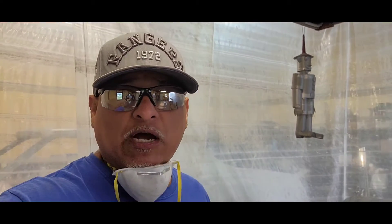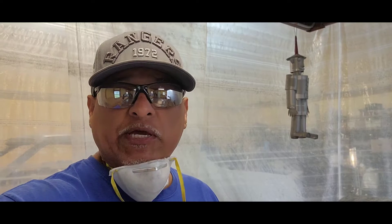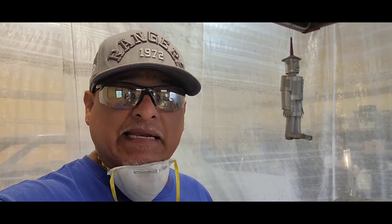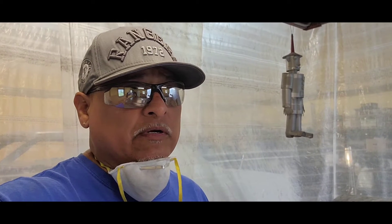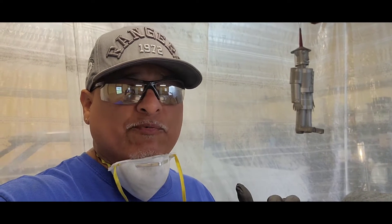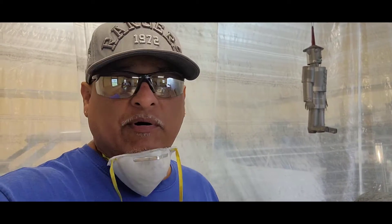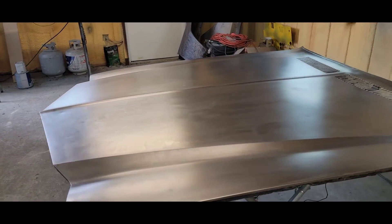Hey YouTube, we're back. Mexican Lee's Therapy Garage, back in the office for a new session. Hopefully we get about a good 2-3 hours in. I want to get my hood sanded with some 80 grit and shot with the Epoxy Primer — HP662, I believe is the part number for the Tamco Epoxy Primer. We're gonna go ahead and knock this down with some 80 grit.